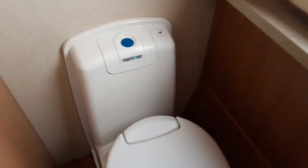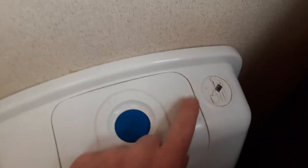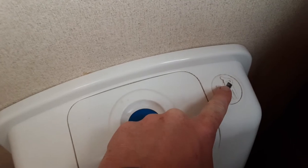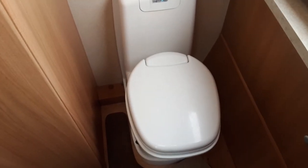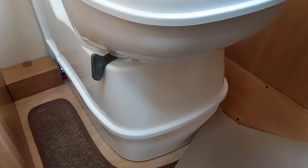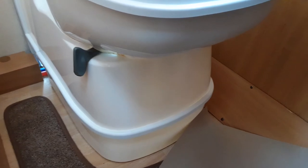Going into the bathroom — the last part of the caravan. The toilet has an electric flush on top. There's also a full indicator light for the toilet waste cassette, which will illuminate red when the cassette is full. The toilet seat does turn left to right for your convenience; however, if it is turned at all, it will stop you from removing the waste cassette from underneath the van. Below the toilet you have a grey waste handle, which allows toilet waste into the cassette under the van. If that handle is open when you try to remove the cassette, it will also lock the cassette in place.